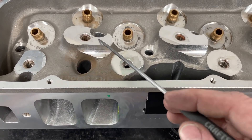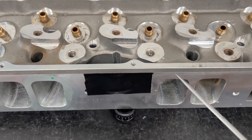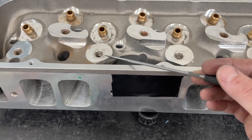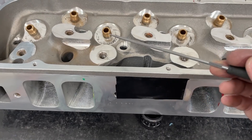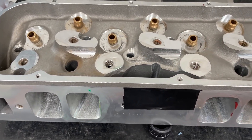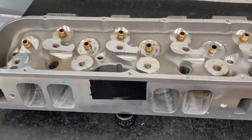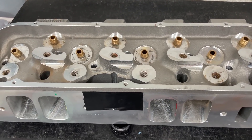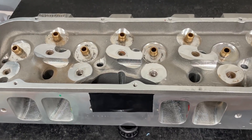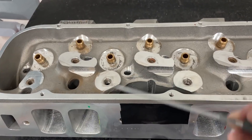I rarely see the exhaust ones pull out because those threads go further deeper in, pulling from a larger area. I'm not saying Brodix helicals pull easily - what I'm saying is I think helicals are stronger and make it less likely. There's also a further option - a large metal insert that grabs material from a wider area. Those are by far the best. There's only one manufacturer that puts those in, and that's the RHS big block aluminum heads. The sad part is their heads are pretty good but you have a hard time with availability and they don't have a whole lot of options. I like that Brodix puts helicals in - I'd rather have helicals than just threads cast in the head.